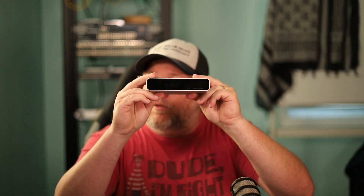When the new CloudKey first came out, they had a battery in these that would do a graceful shutdown in the event of a power outage, because MongoDB was very susceptible to corruption if you just cut the power. In 2022, Ubiquiti changed the way they were using MongoDB, which made the CloudKey less vulnerable to corruption if power was removed. So in 2022, they actually started producing CloudKeys without the internal battery.